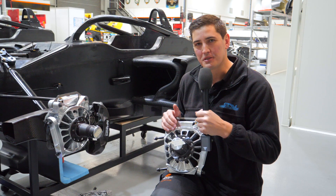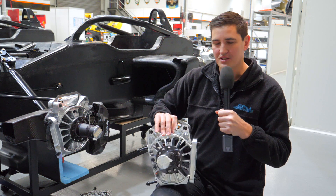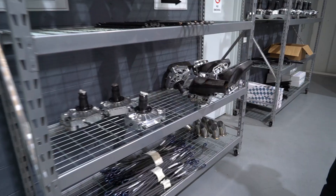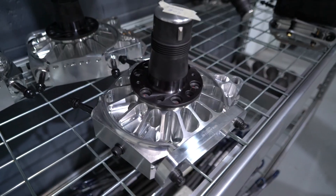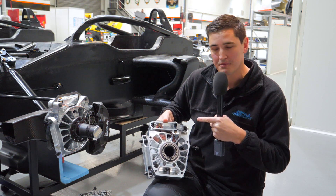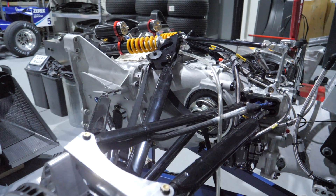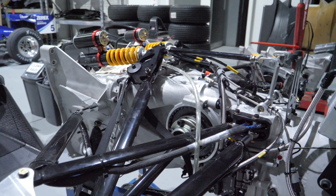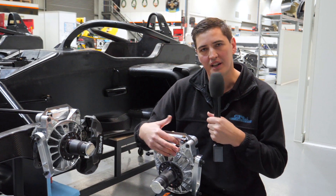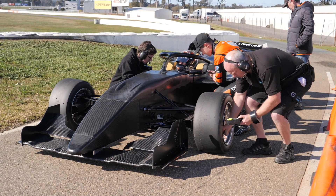When we get to the outboard component of the suspension, this is the stuff you don't see but it's really critical. Hidden behind the wheel is this — one of the uprights off the S5000. These are all locally produced, with spindles coming from Hollinger and the uprights produced by us. The uprights are a billet item and as you can see there's quite a lot of air between the outer frame and where the bearings are supported. This blow-through design makes it really effective at cooling down the brakes and helps keep some weight out of the upright. The other critical thing is where you can adjust performance with camber, toe, and caster angle to give the driver the feel they're looking for and stability on the track.